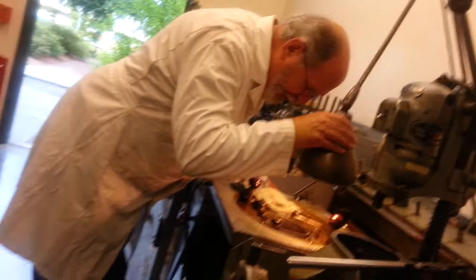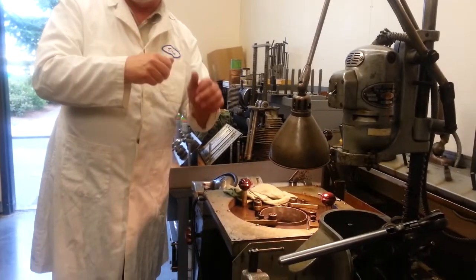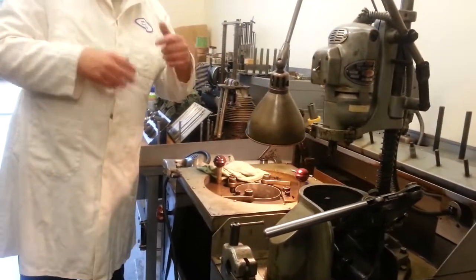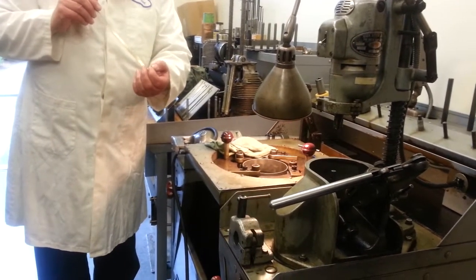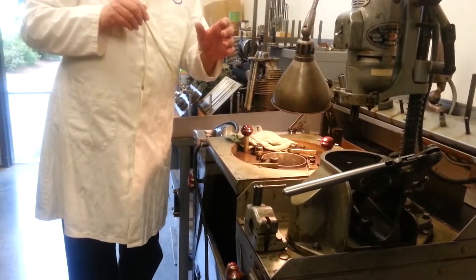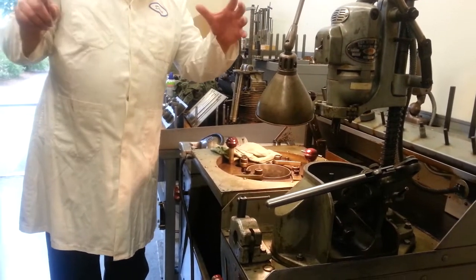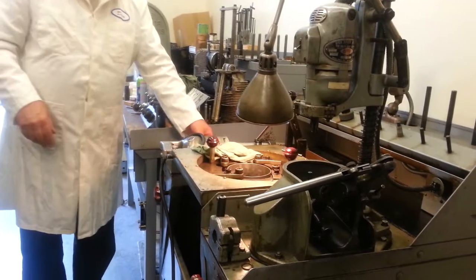What I'm going to let you guys do — I don't want to do this for you — each of you go in there and take a little pulse, just about three pulses, stop, pull it out and look at it, until you believe that the face is clean and the narrowest part is the width of this one-sixteenth. When you get to that point, let me know. Don't take more than you need to take off. If you're in doubt, check with me, because if we take too much off, once the seat has been ground too much it gets too big and you can't do anything but replace the seat.